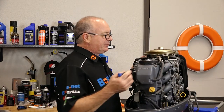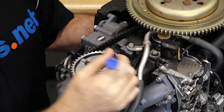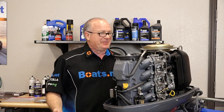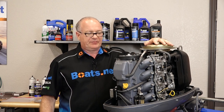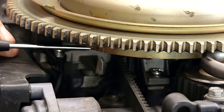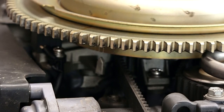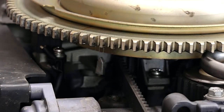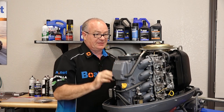Normally I have to bring this around to top dead center, but this one is actually stopped at TDC. The mark you're looking for is this little one right here where it has an arrow in red, going to that mark right there. So it is sitting exactly where it needs to be. Next, what we need to do is get this main bolt off and then get a puller to take off the flywheel slash magnet. The other mark we want to keep an eye on is right here — that T, that line needs to be right where that pointer is. Once we get this off and get the belt removed, it is very important that you don't let the crankshaft or the camshaft turn, because they have to turn together. If they turn independently, you're going to hit one of the valves and bend it. That's what we don't want.